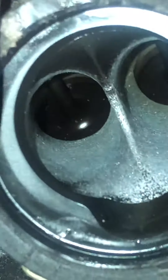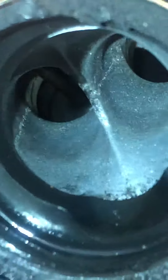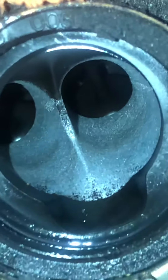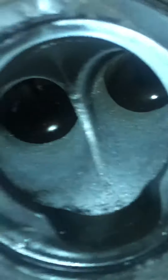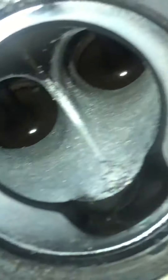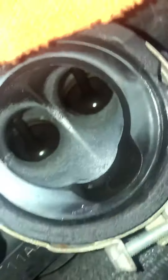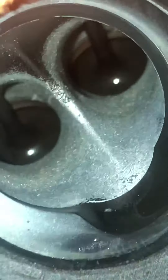I'm going to go to each one and see what they look like. That one in the corner looks kind of beat up. Cylinders one and four had the most oil in the heads. You can see the cornering on that — it looks kind of beat up. Hopefully this motor isn't blown, but it looks like there's a lot of wear in here. This was the worst one — this is number four.